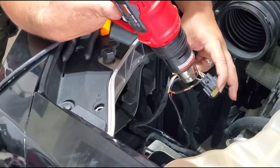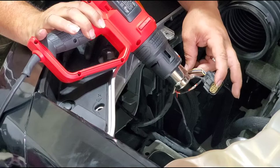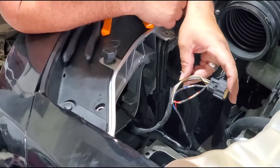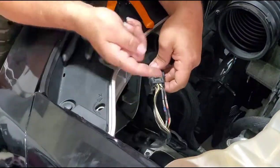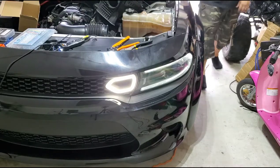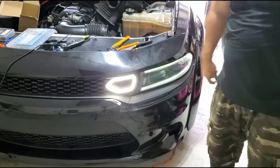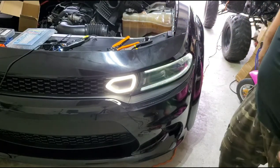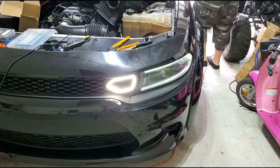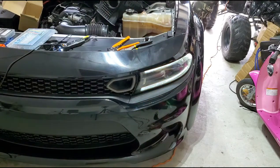Get the heat shrink and solder all melted in there, all nice and connected. Once you're done, tape it all up, connect it, and after waiting for the solder to cure, test your lights. Testing is very important — as you can see mine worked no problem because I followed the instructions, just a bit more professionally when sorting the wire in place instead of just putting the butt connectors on. You can see here I'm turning on the turn signal so you can see it works.